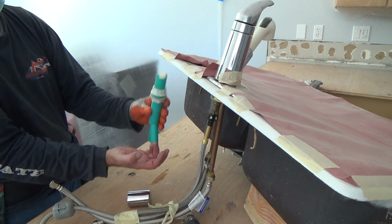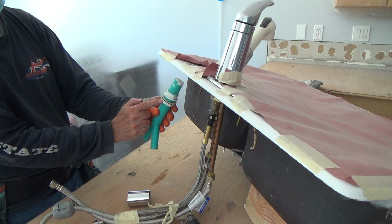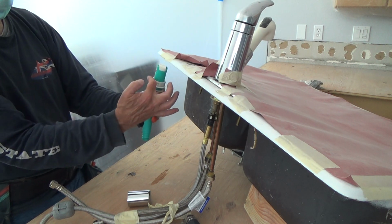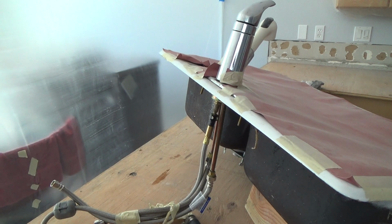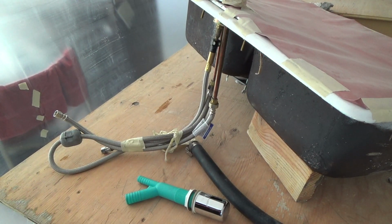So you can just get that loose and get it lined up first, know where it goes. Then you never have to really touch that again. You see, then you can tighten everything up from the top, okay? There's just a couple things for you to consider when you mess around with a dishwasher air gap.